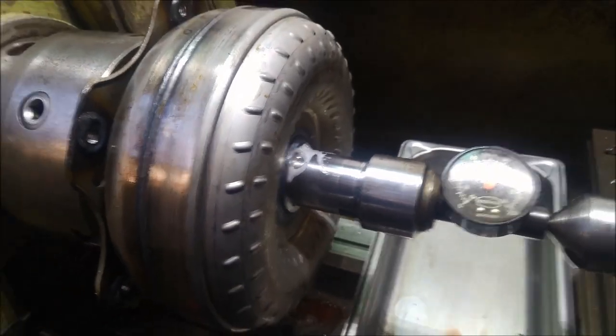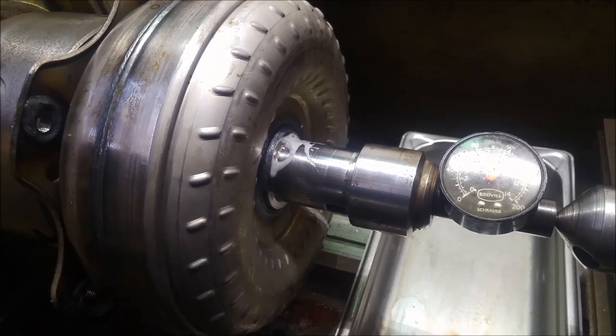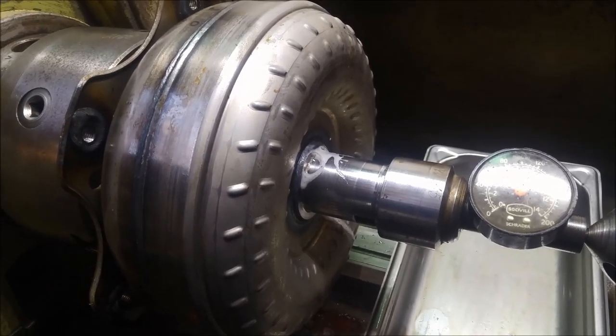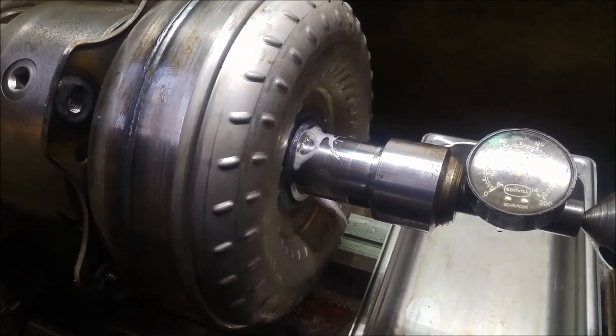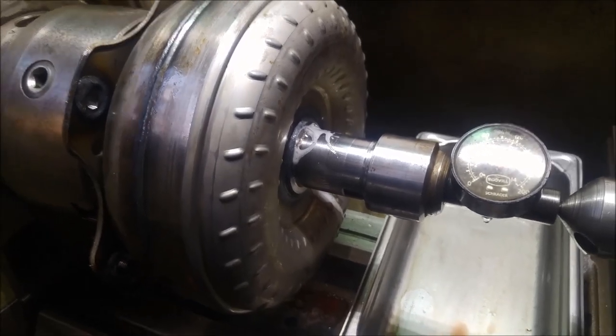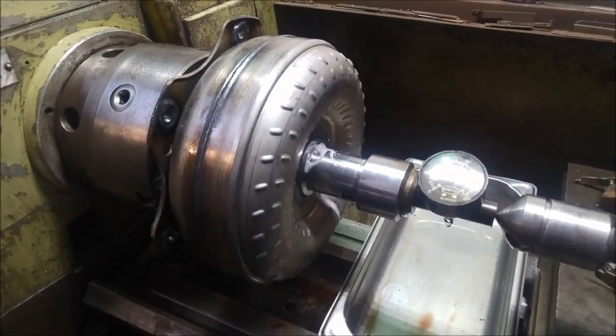Just a little hint for you: when you're trying to fix oil leaks at the front of the transmission, it's not necessarily just the seal, or the bell housing bolts, or a crack in the bell housing — always test your torque converter. Hope that's helped, thank you for watching.